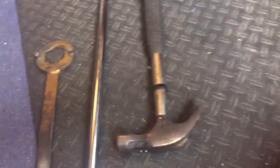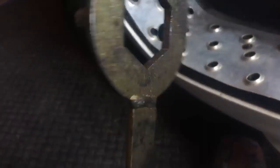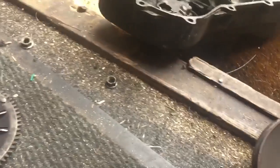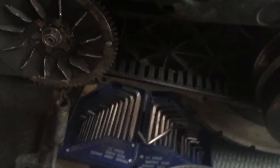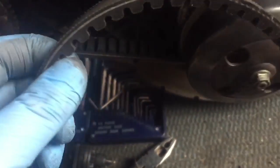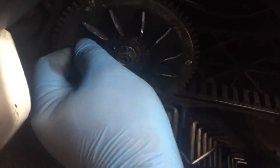The clutch is off - not that great if I'm honest. Clean it all up. The rollers are all round but very dirty - give all that a clean. You need that little bit there to get the clutch off, there's no other real way of doing it - clamping it maybe, and then obviously the claw hammer with the claws in that way. That's off - clean it up, get it all back on again. The brand new belt is ever so slightly wider than the old one, but that was baggy as hell. You'd be revving up before you pull away. This one is nice and tight - that's where it should be.